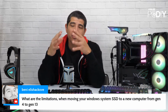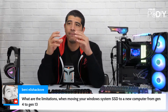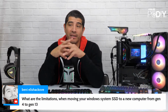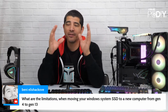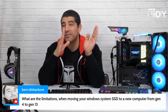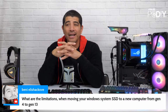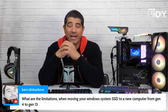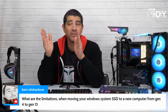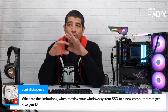One, you probably didn't even install your operating system in what's called a GPT compliant installation, which is the way that hardware gets initialized. For Windows 11 and modern systems, you ideally want to be in a GPT compliant installation. This helps to ensure that all the devices are addressed in a native UEFI based formatting. It helps ensure the fastest and most secure boot and post environment experience. The reality is, long story short, don't do it. I would back up your data and do a full, fresh, clean installation to ensure the best stability, reliability, and performance. So I would not migrate my drive over in any way, shape, or form.